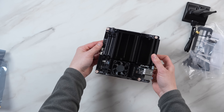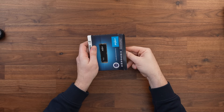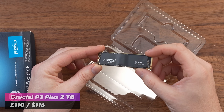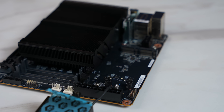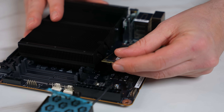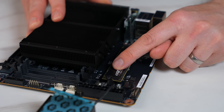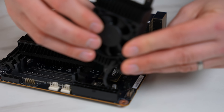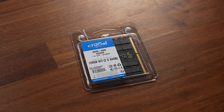I'm going to need to remove the SSD heatsink and install my drive. Today I'm going to be using a Crucial 2TB P3 Plus. Now the P3 Plus is a really cheap entry-level Gen 4 drive, perfect if you need to keep your budget down. I normally use a faster SN850 drive, but sadly all my SN850s are in use in other projects so we're going to stick with the P3 Plus today. Once we've slid the drive into place and locked it down with a little pin, we then screw that heatsink back over the top of the drives.